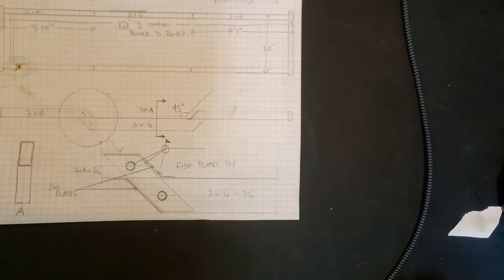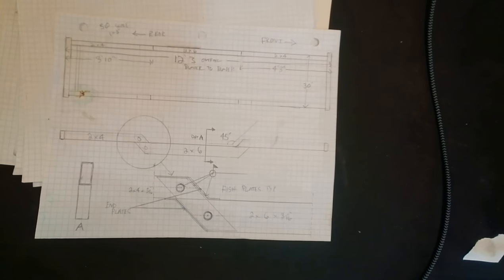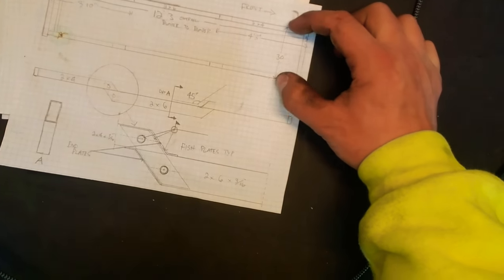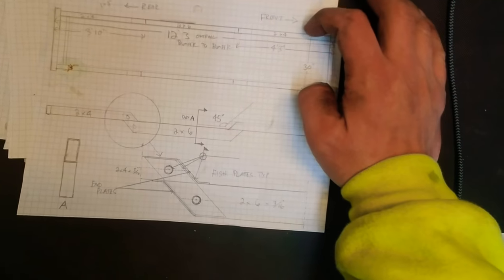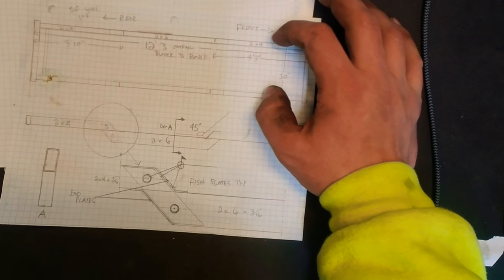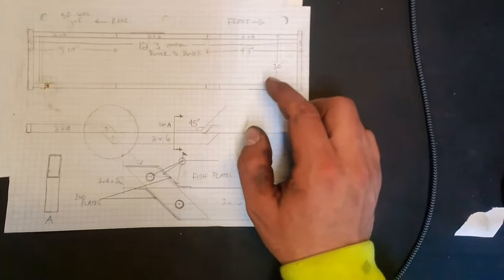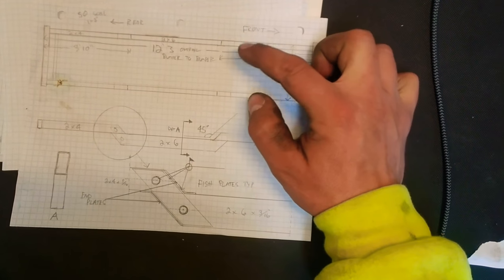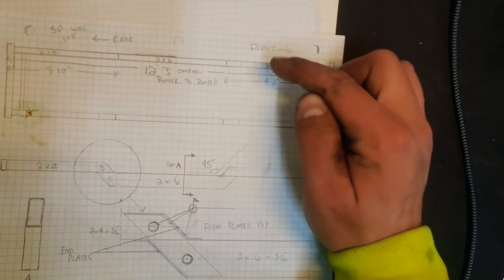We weld stuff all the time in the field doing iron work and they don't ever seem to be concerned with it there, so I don't know why it would be any different here. It's going to be approximately the same length as the factory frame, but instead of being narrow in the front, bellying in, going down, and then getting wider in the back, it's going to stay parallel. We don't need all that extra stuff. We'll have a little bit of extra room from the front to work with, which gives us more ability to fit exhaust. You also don't want them super duper close — you have to have big outboarded hoops for the coilovers. They're still going to outboard a little bit and then be braced back, maybe braced across the top — I haven't decided that yet.